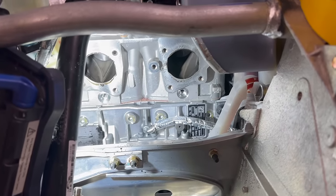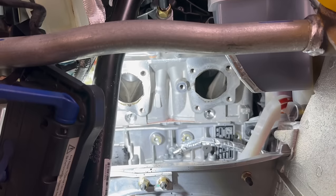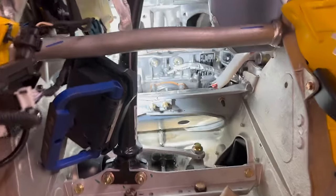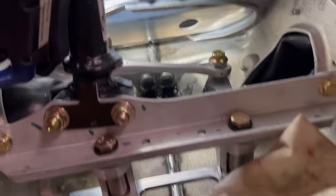Pipe is out of there. Gasket separated, really clean. I'm gonna have to take a little bit of a razor blade to it real quick in a couple spots. There's just tiny little spots of gasket right here, and I think there's one on the other side, but all in all, popped it out of there pretty clean. You have the classic new sled break-in kind of oiling out of the Y-pipe there in the bottom. I'll clean that up. That's very normal.